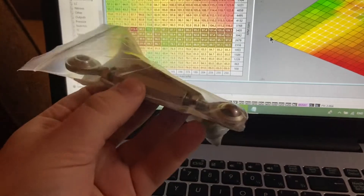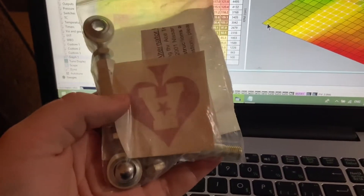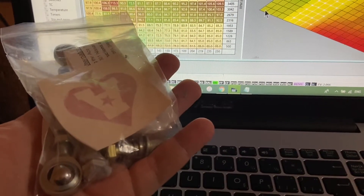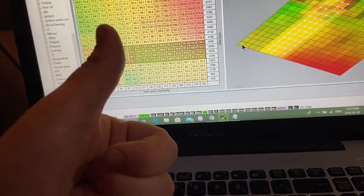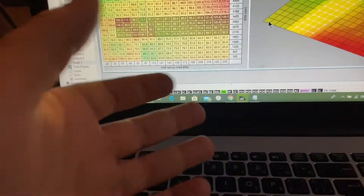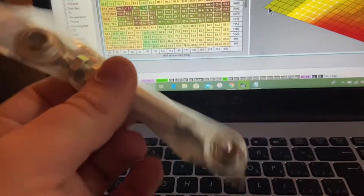I'm not installing a fancy carbon fiber splitter — this right here is from Cody Ace. Go check them out, just Google 'Cody Ace alternator bracket.' One of the biggest problems with the 240sx is the factory SR alternator is, I believe, 85 amps. Think about it: you have a fan that's 30 amps, an ECU pulling maybe 5 amps, headlights pulling 15, your car deck pulling 2 — it goes away very quickly.